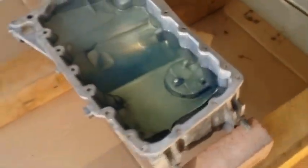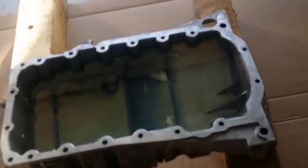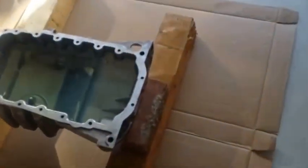Alright, so this is one day later. And it looks like all the diesel is still there. No drops here anywhere. This is just the tank that I put here that I was gonna try to suck the diesel back into it, but I have to raise this even higher somehow. But yeah, this is a really great test. Diesel does not evaporate in normal conditions. So, there you go. Perfect way to test pretty much anything for cracks and leakage.